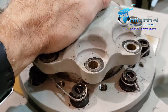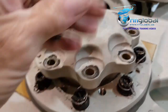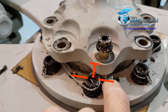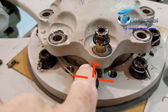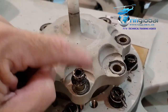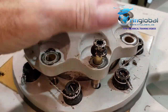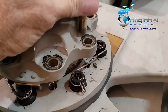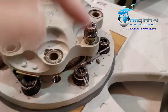Imagine for one second that you hit the 25 foot-pounds right here. When you put it in, you can see that between this hole and that one, if you make a straight line, it is before the centerline. That means after you hit the 25 foot-pounds, you are not going to back it up to this one — you're going to back it up to that one. So this way it's going to be installed.